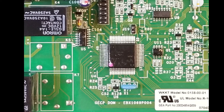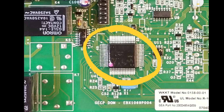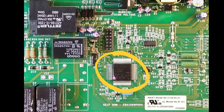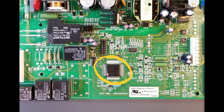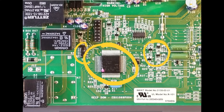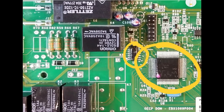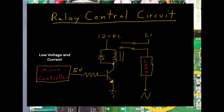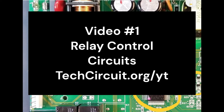Central to this control board is the microcontroller, which contains a program responsible for initiating and maintaining all necessary functions to control the refrigerator. The microcontroller features numerous pins, mostly referred to as ports. Each port can serve as an input for monitoring, an output for control, or both for bidirectional communication. Output ports, often used to control loads like relay coils and provide PWM signals, are typically isolated from those loads by buffers such as transistors, which enable a small voltage or current to drive larger loads. A relay control circuit exemplifies this use of buffers, as the microcontroller's port can only supply 5 volts and source or sink a maximum of around 20 milliamps.